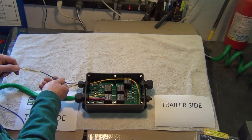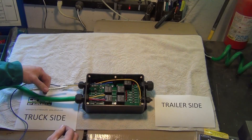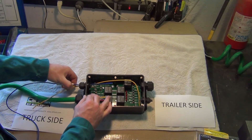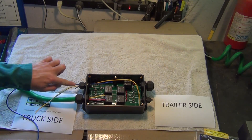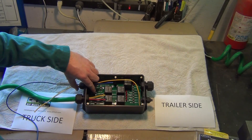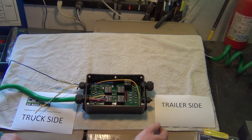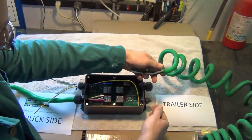You'll see these wires are loose in here right now, and when we tighten this down it creates a seal — it tightens those little holes down and fills them all up. There's also the capability for bringing three wires through this connector. I'm not going to be using all of them right now, so I put an extra wire in there just to fill the hole so that no moisture can possibly get inside the Jackalope.